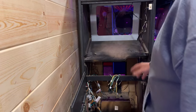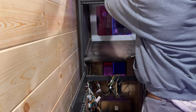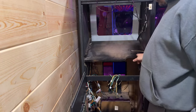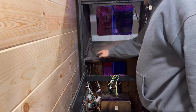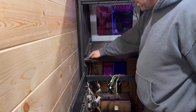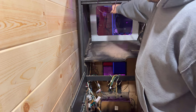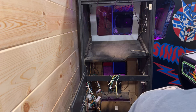I'm going to go ahead and put these two on and then I'll come back and we'll get it slid in place. Okay, now there's actually a ground strap on both sides, so both back nuts need to have the ground strap put around them. So now let's get this monitor slid up into here. I'm going to take this power wire and just kind of get it out of the way — stick it around this handle up here. The nice thing about these Williams cabinets is you can slide this right in and then there are two holes here and here to put your bolt down.